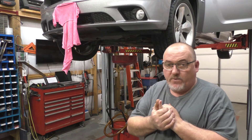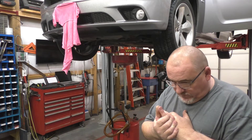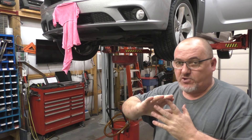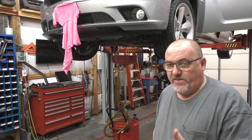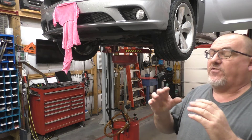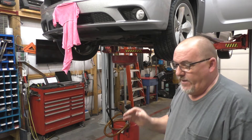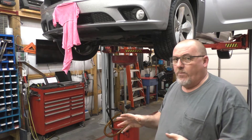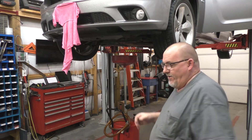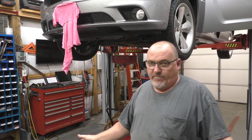The possibilities here are dirty oil chambers, low oil pressure, or clogged screens. More often than not what we see — and I think this is the reason I'm heading this way first — is wrong motor oil. Full synthetic only; this engine should not have conventional motor oil in it. I think that's exactly what they had in it.